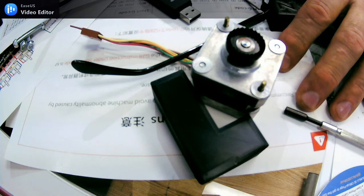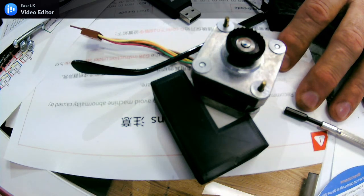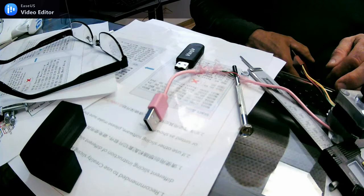So apparently Creality doesn't isolate the 5-volt line into their motherboard from the USB port, which they convert to an RS-232 signal, and their board gets confused and sometimes just burns up. So of course Creality doesn't publish any of this, so I figured maybe I'd save a few people hassle and heartache if I did.